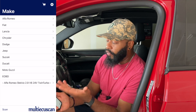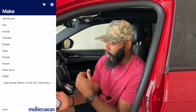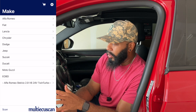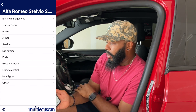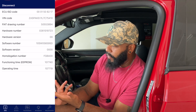As you can see, it works for a lot of brands under Stellantis — Alfa Romeo, Fiat, Lancia, and more. Since I've already set this up to my Stelvio, you'll see it at the bottom, but I'll run you through picking your vehicle. Go into Alfa Romeo — it's a long list of model choices. There's the Stelvio at the bottom, and it gives you choices between the 2.0L, 2.9L, and 2.2L. I've selected the 2.9L. In here we have different systems to go into; we're going to Engine Management, split up by banks of the engine, and then connect.